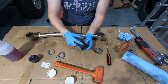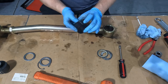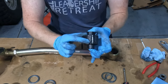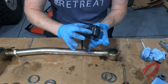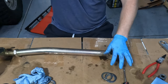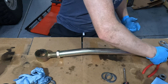Next, take the supplied grease — don't use other grease, only use what's supplied or what Metal Cloak recommends. Grease the whole bushing, then take a little bit extra and try to put some in these little grooves. Set it right in there, then take whatever little bit extra is on this side and use it on the other side.